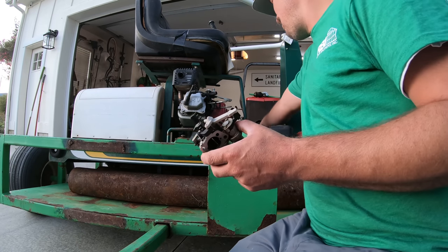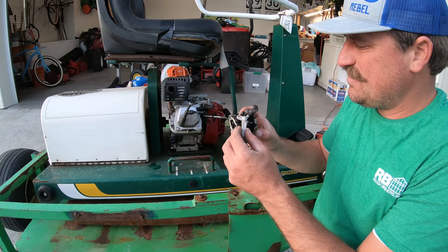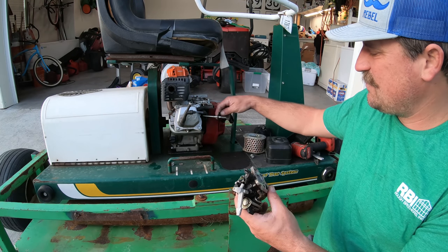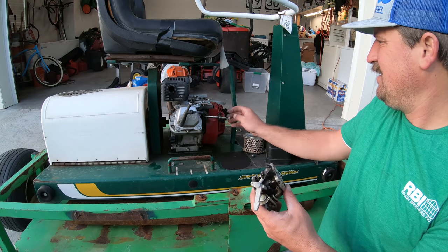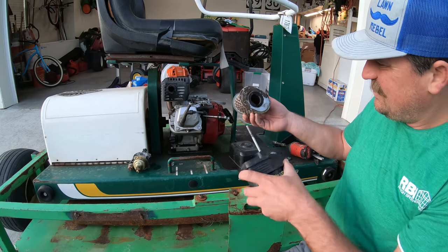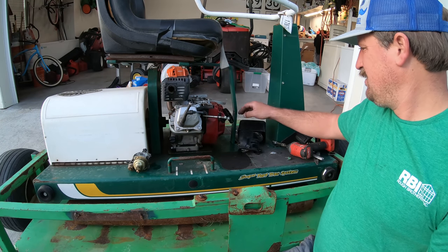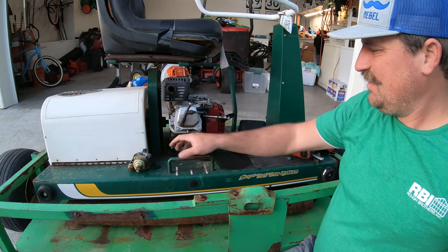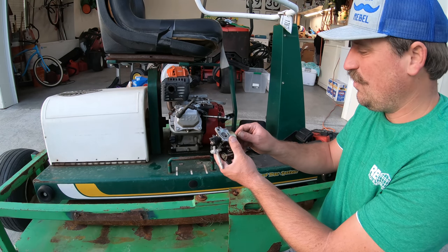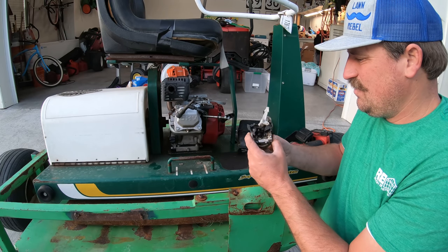I don't know how you do that — it's scary. Okay, so the carb is clearly disgustingly dirty. See all the nasty oil here. Bad gasket here where it mounts on the machine. I just want to make sure I'm not losing any of my parts or pieces. See how dirty that thing is? That's disgusting. So — new air filter, clean this thing up. I need to figure out the model number and get a carb rebuild kit. It's going to have a gasket, likely a new float for the bowl, new needle. Just need to figure out what kind of engine this is and order a new rebuild kit.